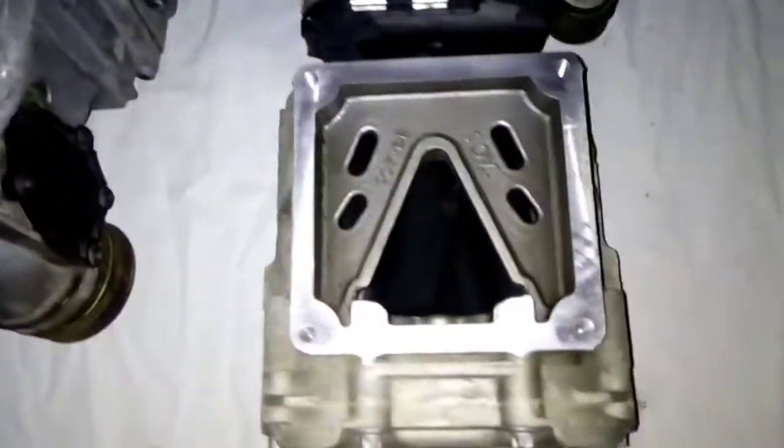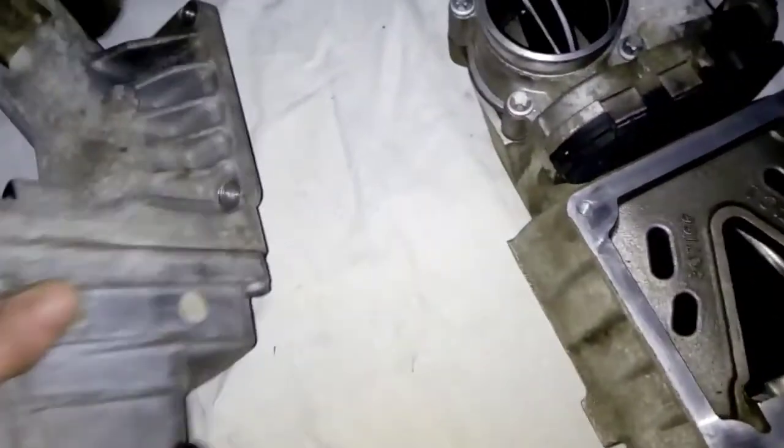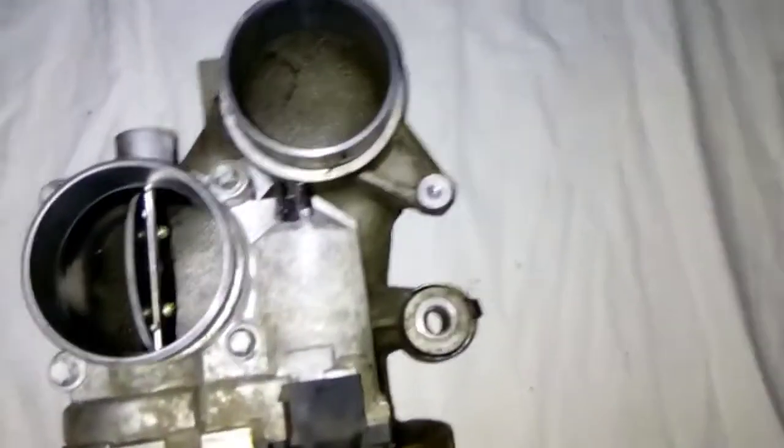The rotors inside are about half to three-quarters the size of the old M62. The bypass valve goes there, that's your air intake, and this half fits over the intake. It fits on the bypass valve so that it recycles the air. That's your intake, and this bit will go to the intercooler and then to the throttle body on the main engine. This was fitted to the M271 1.8 engine and provided plenty of boost to that particular variant of the Mercedes engine.